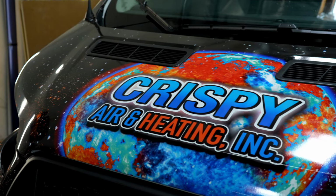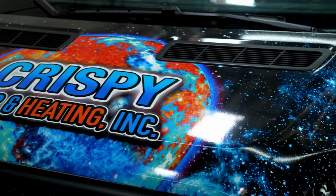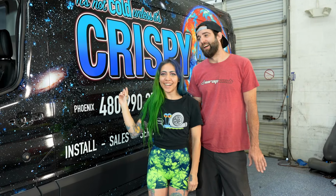And then as far as the finishing touches, for trimming and post-heating, super important. You want to be at around 180 to 200 degrees for the 2 mil film. I would recommend edge sealing. When in doubt, seal it out. At least corners and maybe some stressed edges, because fingering on this stuff, it does come back a little bit on edges, depending how much you stretch it. So when in doubt, seam it or seal it out.